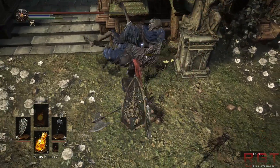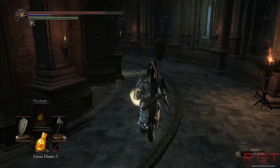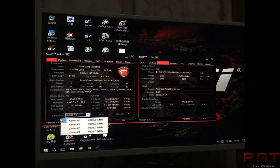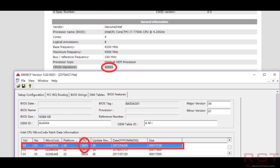This is a small update to yesterday's video, coming from a bulletin board system. There was an individual who modded a Z170 motherboard — I think it was the MSI Gaming Titanium — and it allowed an i3-8350K Coffee Lake CPU to run on it, so that's a 300-series CPU on a 100-series motherboard, which Intel told us was impossible. The user tweaked the power distribution and modified the BIOS itself. There were caveats: the processor functioned normally, however the integrated GPU did not, and the primary PCIe slot also didn't work.